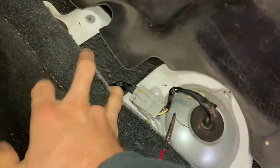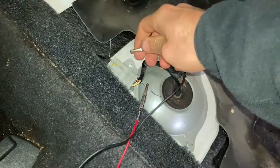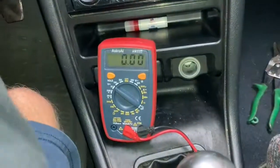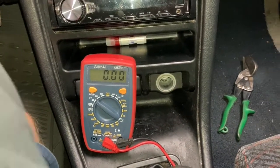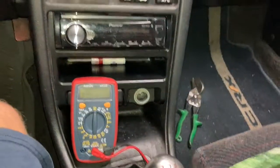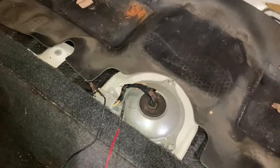Make sure you're actually tapping into the correct ground on this connector. I came in from the other side just so I don't run the risk of the two wires touching each other, which would throw off the voltage reading. That's how I recommend doing this — and that reading goes up to 10 volts, so just make sure you are on the correct settings.